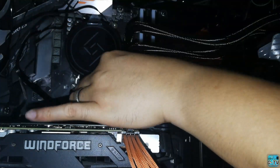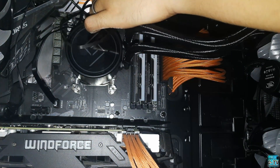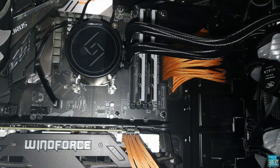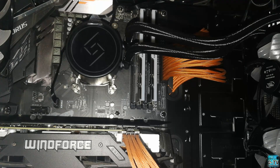And for the wiring, connect both fans to the included hub, then connect the hub to the motherboard's CPU fan header. Connect the 3-pin CPU pump cable to the CPU opt fan header. Connect the RGB cable of your fans and pump to the RGB splitter, then connect the RGB splitter to the included RGB sync adapter, then the adapter to your motherboard.